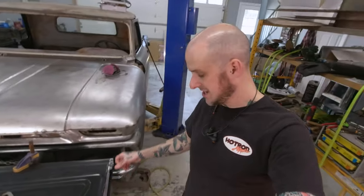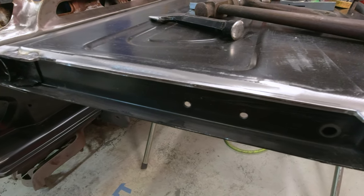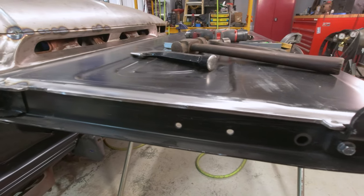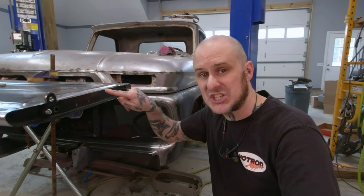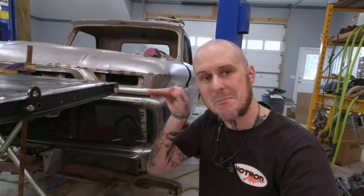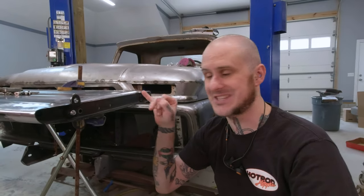Now I've ground back and cut back those flanges a little bit. I need to go ahead and reattach this — the spot welds on one side are completely gone, and on the other side they're barely hanging on. So I need to reinforce that lip, that flange, and make it stronger. I'm going to go ahead and stitch up right along the edge of this panel. I'm going to clamp these two panels together and run small beads stitched along the edge of this thing, trying to focus my TIG welder into the joint between the two panels — trying to get maximum penetration with the smallest amount of weld buildup, because I need to grind whatever I put on there flat to this surface. I can't afford to have it expand outward because that's going to come into the area where those lift straps need to stay.